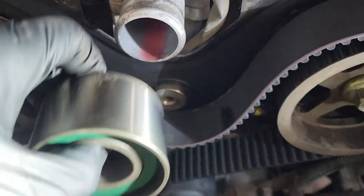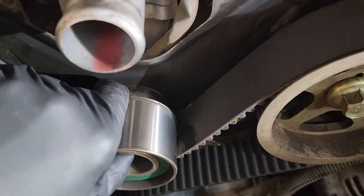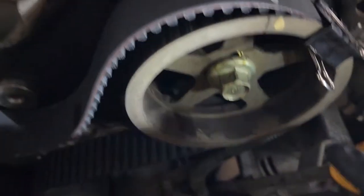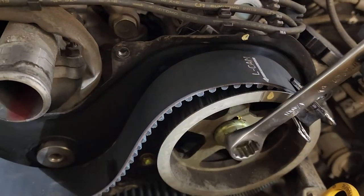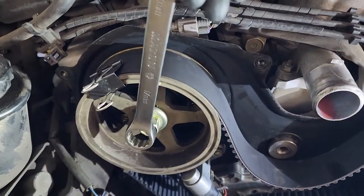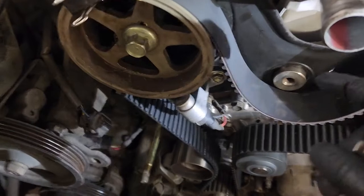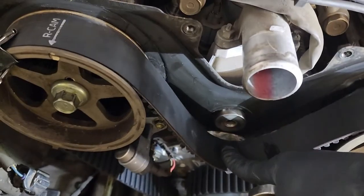Now to get this idler back in here, it can't quite fit because the belt's a little bit too tight. So what you're gonna do is take a 17 end wrench and rotate this direction to take any of this slack out that's right here. And then on this one, you're gonna rotate this way to take the slack out where the tensioner is. And then that'll put all your slack in the belt right here, so you can get that idler back